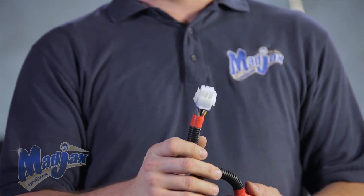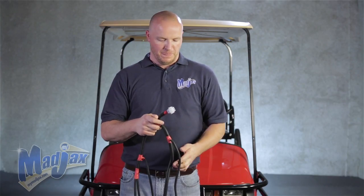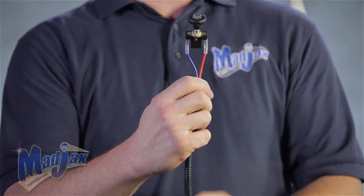The purple and black female spade connector will go to your new horn for your upgrade. Down from the horn you'll have a nine pin connector. This attaches to the turn signal assembly. Down from the nine pin connector, you'll notice your hazard switch. This has a red and a blue wire.